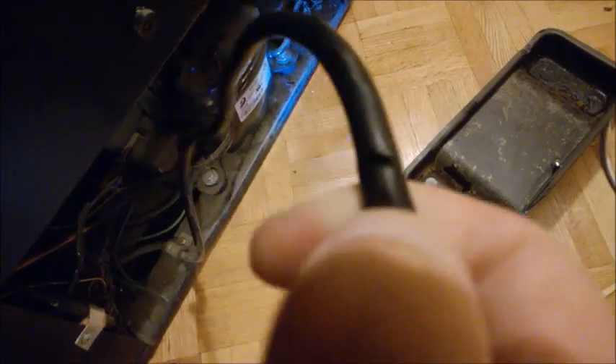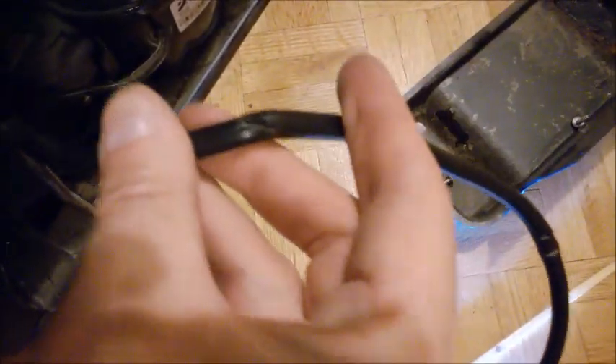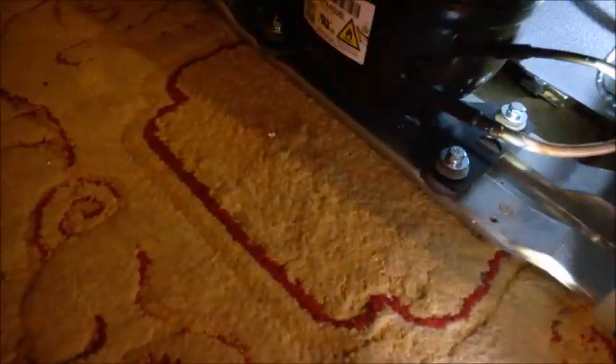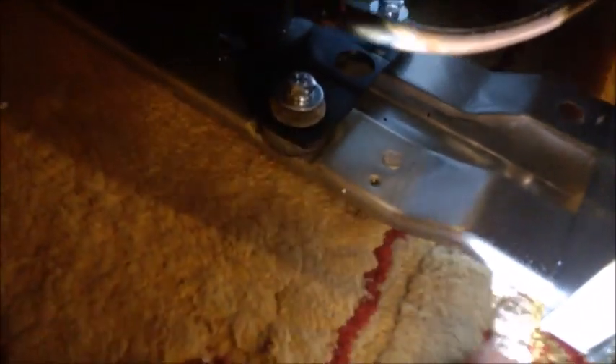There's another place here again — cutting through from moving it around. Very, very dangerous. If you see this, it's better to cut the wire, rewire it, and use a new wall plug. Look at this — it can cause a short and you could find your home on fire. This new fridge is the same design — very sharp metal bar here, and the cable gets on the side where it's lifted, then gets trapped underneath and severed by the weight of the fridge. Very poor design.